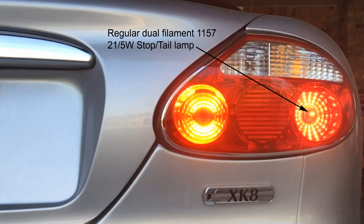In order to get around that you need to put resistors in with equivalent resistance and equivalent wattage. The 25-watt resistor — the one that replaces the stop lamp — is a pretty big device, and it also needs a smaller one for the five or eight watt tail lamp. So it wasn't actually very practical in this case.